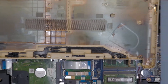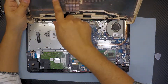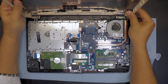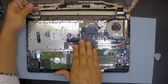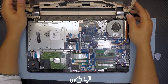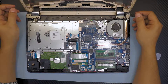The only thing I don't like is the ventilation — there's no ventilation opening in the case. It's supposed to be right here where the fan goes, but the holes are right over there. The air has to suck in from the middle, go through the fan and out. Which is not good for the CPU, but it is good for other components — but they are not installed, so it's pretty much useless. The things that heat up in here are the hard drive and the CPU. The RAM doesn't matter too much.